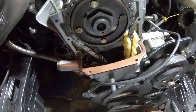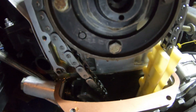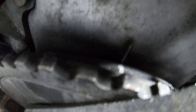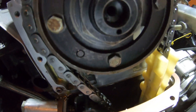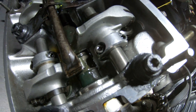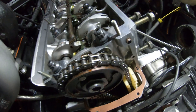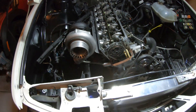Here's the final look — all put back together. We've got the tensioner back in there. Once again, dowel at about seven o'clock, everything lines up on the bottom. The bottom mark lines up on that timing cover mark. Note that the bottom mark could line up while the dowel is up over here, which would mean you're 180 degrees out — so the most important thing is just to make sure that dowel is at the seven o'clock position. I also put a little bit of Lucas oil additive and some oil up on the cam while I turned it over, just so it isn't completely dry — not a bad habit on a new build. Hopefully back to life with the rest of it soon.